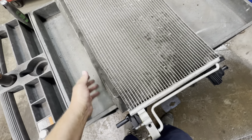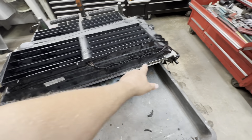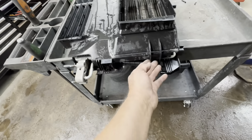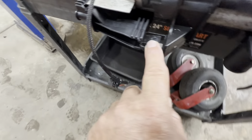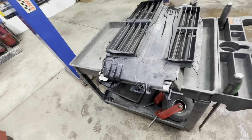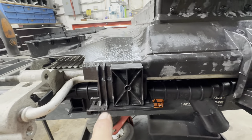I didn't remove my foam from the condenser — just lifted it off the radiator a little bit. Now put your shutter doors on. Make sure you've got the bottom on the bottom — the wire harness is on the bottom, the top is the top. Line up your shutters into there — that one goes in — and then clip it in. Hold it up a little and push it in. Same thing on the other side. The shutter shroud clips right in — flush on both sides.